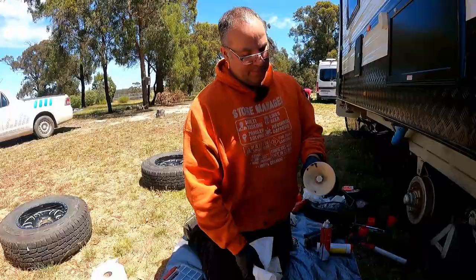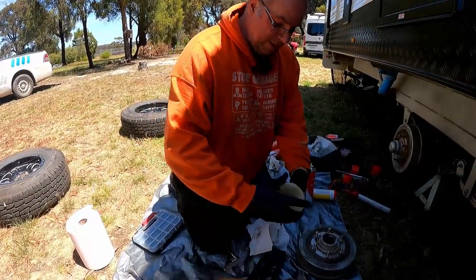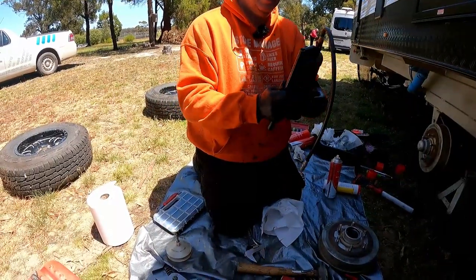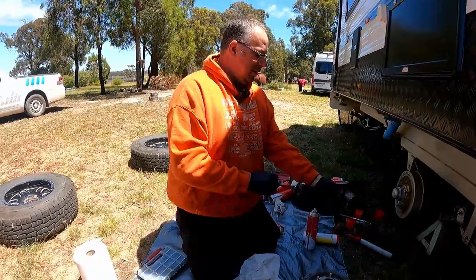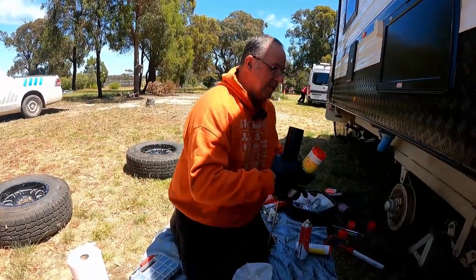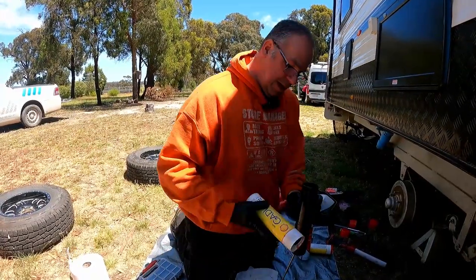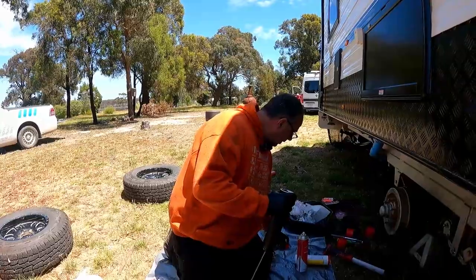Once you've got it all nipped together nice and tight, you find your grease gun. Plug it onto the nipple, just on the top there. Now this is out of grease, exactly as I thought it would be. So we're just going to change the cartridge. Bit too much suction. Top off, stick it in there, that can go in there, that's rubbish.